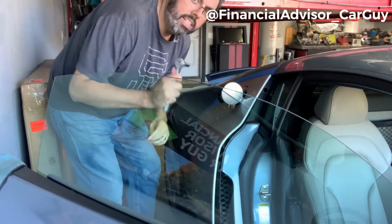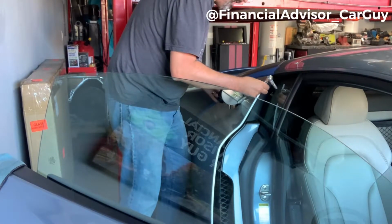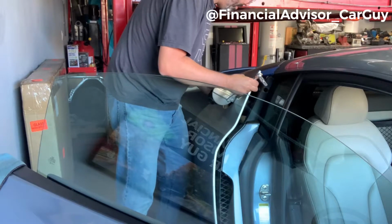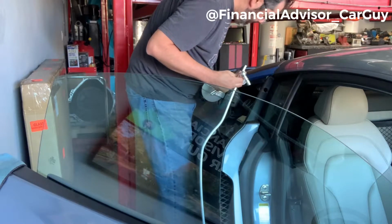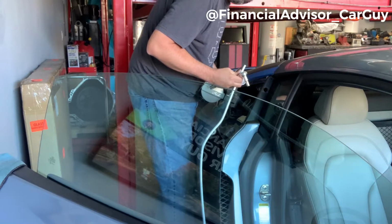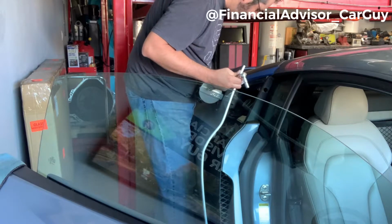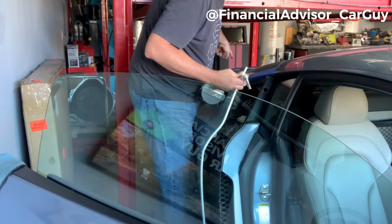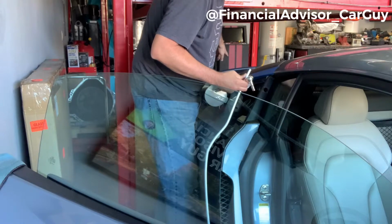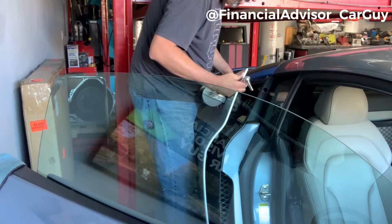So now that I have my 10mm, I can proceed forward. So what we do again is slide this off the car to the front, pull it away just a touch. And the reason you only want to pull it away a little bit is there's a couple of lines. One is the emergency disconnect for the fuel tank. And so if I rip this thing off the car, it's gonna disconnect. There's a cable in the back here that has a switch that will disconnect the flow of fuel. So we don't want to disconnect that.